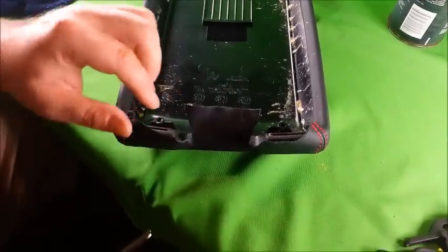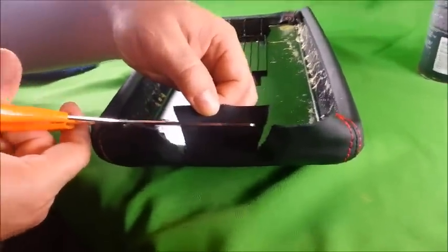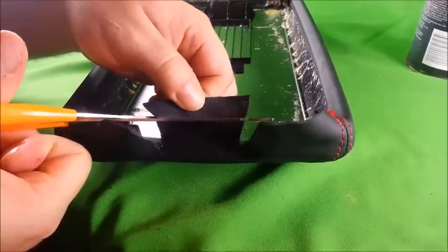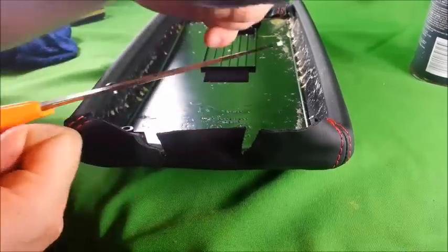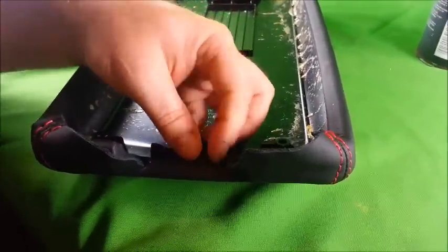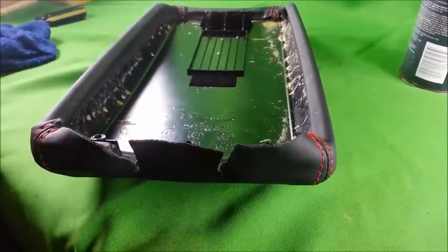Okay, so you've made your trims, and next you want to remove the excess from the center flap. It's not needed and it's in the way. So trim the center flap off. That leaves you a smaller piece that's easier to fold. And now we're going to first put this piece in place.